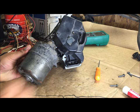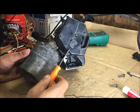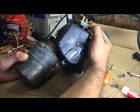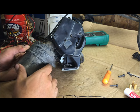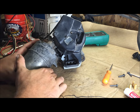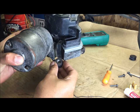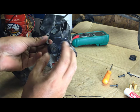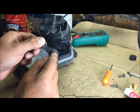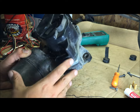Hello, I'm Chris and today I'm going to be doing a Chevelle wiper motor with the mechanical washer pump. It's got three terminals down here and two right here — this one had the little squirter straight out. I want to make it very clear that these are grounding straps, not insulators off the firewall. They are actually ground straps strapping the body of these two parts to the firewall, so these will be grounded.